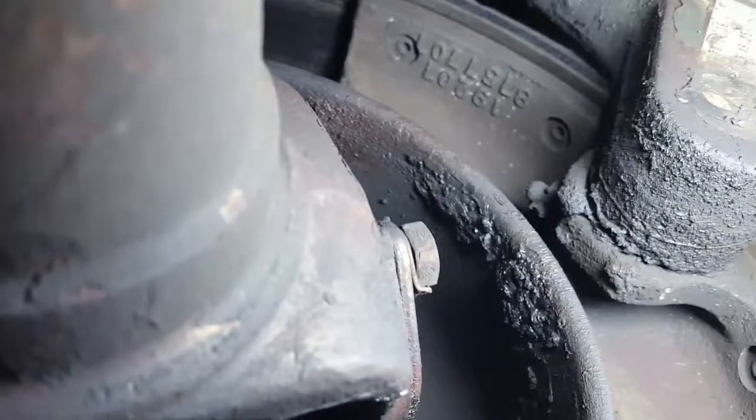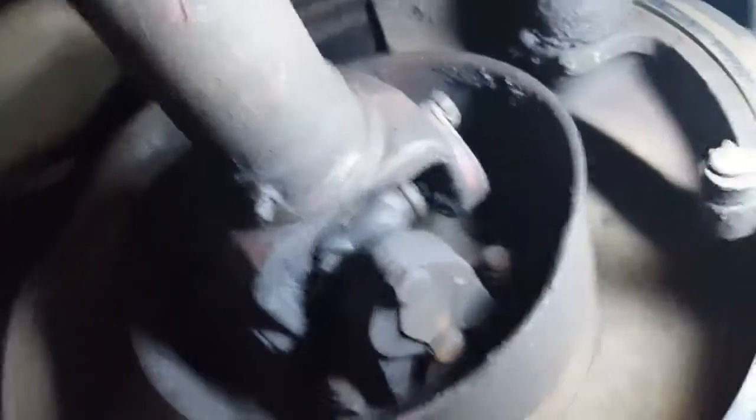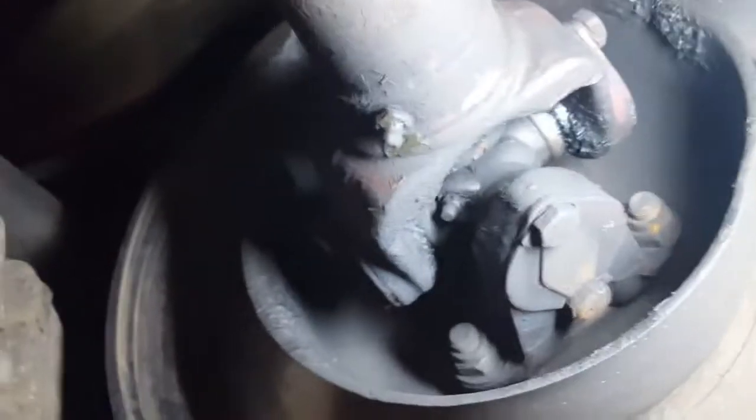Making our way back, the backside of the transfer case — you've got two grease fittings on the outer part. On the brake shoe pivot you've got one grease fitting up there on top where the second pivot is, and you've got one grease fitting right there on the back side of the inner shoe. That's it for the park brake assembly.